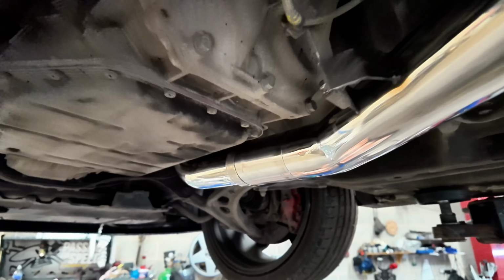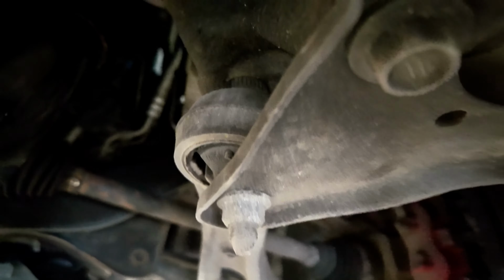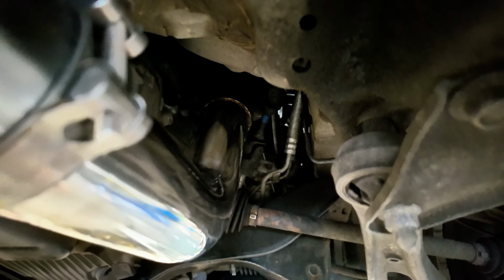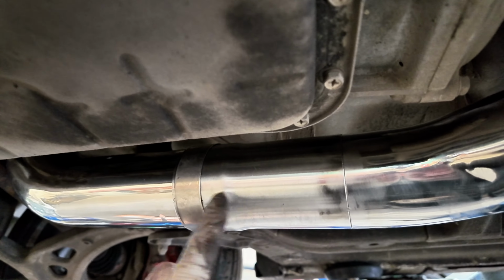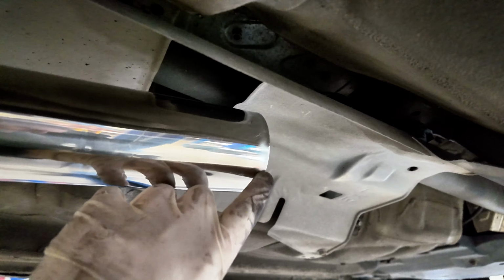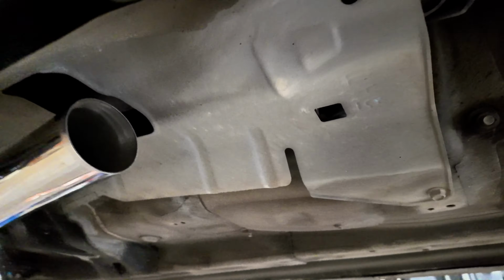Right, guys, sorry I've not been doing much videoing. It's not really much to see. So that downpipe, what I showed you earlier, is now on. We have had to modify it slightly here, so it was 5 inch too short to clear this gearbox. I don't know what that's about. So all we've done is added 5 inch into this, and clamped that onto there. Now there used to be a 2-bolt flange here, and we've got rid of that, basically because we don't need loads of joints.